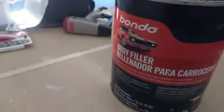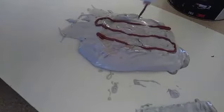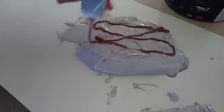Now we're going to mix some bondo, which is bondo body filler, believe it or not. So we got about a 7-inch puddle here, pretty thick. We got a lot to do, so it's about 1.25 inches. So we're going to add 3 strikes of hardening cream right across. Go one more. Pretty thin on it. Okay, that's going to activate and harden the bondo.